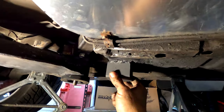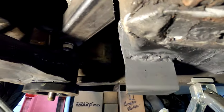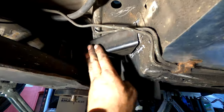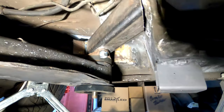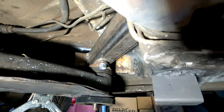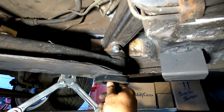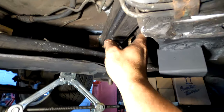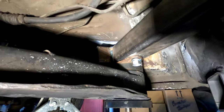This doesn't look too bad — we're working with a chassis that has limitations and wasn't really made for this. I really like this a lot better than last time. The biggest thing is that this can now be detached from the mount — before I just had a stud welded to this and this was welded to the frame, so there was no way to service it, no easy way to drop the subframe. Now you can loosen and drop the front part for whatever reason — just like factory.